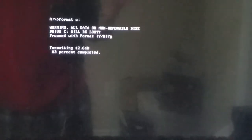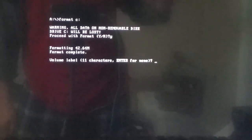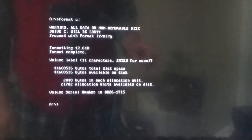hard drive does not destroy the drive, but, and I really want to stress this, you have to, one, use the tools supplied by the manufacturer themselves. Don't just use some generic so-called low-level formatting tool. And two, make sure you back up your data. This drive, I already got pre-wiped from the seller, so I didn't worry about any data that could have been lost. But I made sure that whatever I was using to format this drive, it came from Seagate themselves.